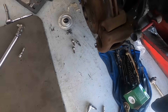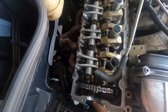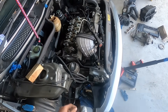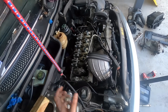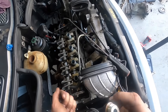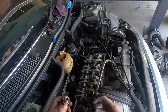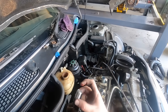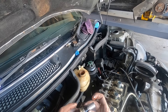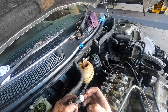Just putting everything back together with the chain - I looked down and saw the chain was just off the guide rail a little bit. Rather than unbolt all the cam gear again, I just took the guide rail off slightly and used a screwdriver to push it back on. Now I've got to deal with the tensioner. Luckily I've got a new one - the old one I'd have had to compress, but this new one I can just slip in there and go around the back of the engine to fit it.